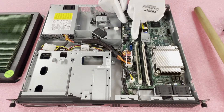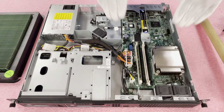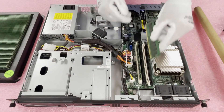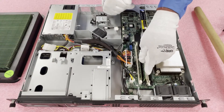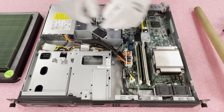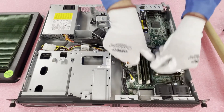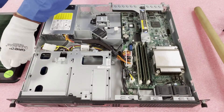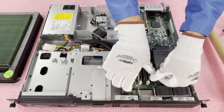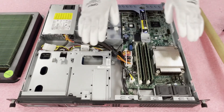What ends up happening with the tabs is you can see how the tabs are further back on three of these than the first one — the tabs click into the side and actually physically pull the module down a little bit, which puts the leads into the slot and that's how everything is registered. So you want to hear click, click — just that simple. And again, if you were only putting in two modules, you would put them in the two white slots. Since I'm maxing them out, I'm putting it in all of them. People ask us why, and really it's all about maximizing your performance. You don't want to overload one channel while another channel isn't working for you — you want a nice, even distribution of load across both channels.